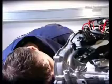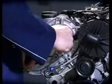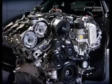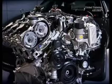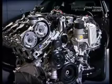First remove the front lid of the right cylinder head. Then remove the following components successively: the secondary air pump, the belt guide pulley, the coolant thermostat, the belt tensioning device, and the oil filter case with the heat exchanger.